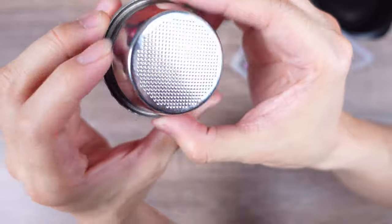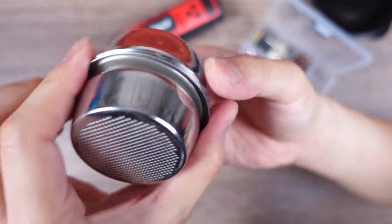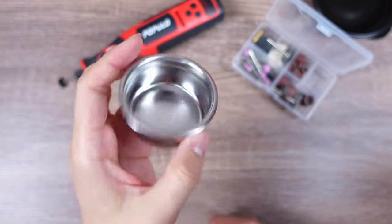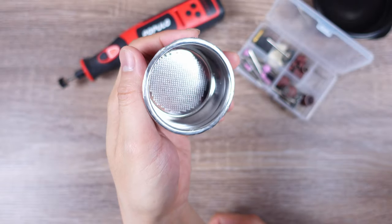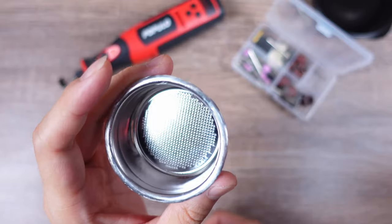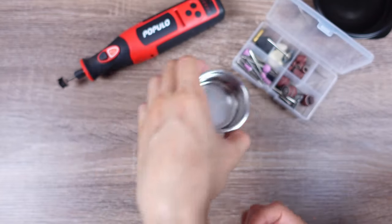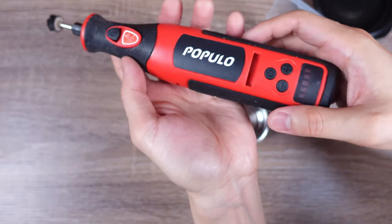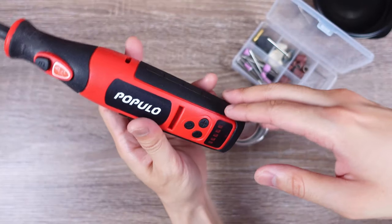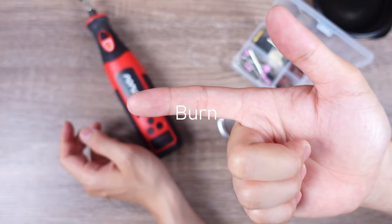Just comparing it to the original Breville — it pretty much matches up at this point. It's not perfect, but I just tried it on the Breville Barista Express and it fits. For those thinking about doing this at home, from my experience it took about four hours including charging and cooling the unit. If you have a heavier duty machine or more skill, you'll obviously finish much faster. The bit I ended up using was the diamond bit, finished by buffing with a sandpaper bit and a wool bit with polishing compound. One more thing: follow the instruction manual for recommended RPM for whichever bit you're using — wrong RPM can overheat your unit or burn the metal.